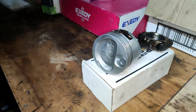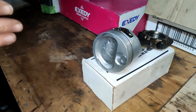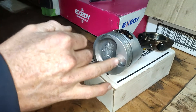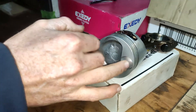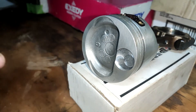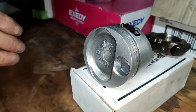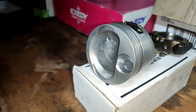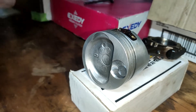I'm going to talk about the ways I could fully get the power of my cam with this motor. As you can see it's all hollowed out - all that is compression loss, same with this, but it's minute compared to that. It's 2mm deep, but hey it'll run - it's a $50 motor, who cares. My plans are eventually if it runs good with no issues and I want a bit more power, the best thing I could do with this motor is go to Ross Pistons down in Christchurch. They make forged pistons - they don't make the forged rods, I'll get them done somewhere else, but he knows a guy who does that.